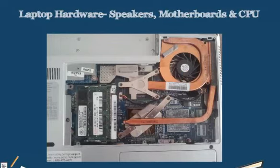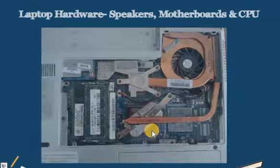Overheating is a common issue with laptops. Say, if you are using them in places like on a bed where there's a mattress, or directly on your lap for a long period of time and blocking that exhaust port, we may notice that the bottom of our laptop gets very hot. There are additional solutions to that.